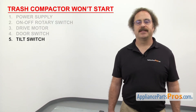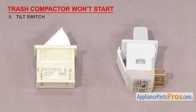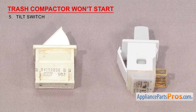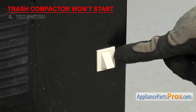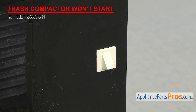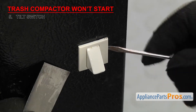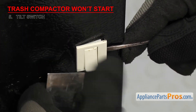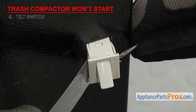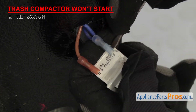The last thing to check is the tilt switch — it's a safety device that shuts off the power if the drawer is forced open during a cycle. The tilt switch is a small switch with a rocker arm and two wire terminals; the rocker arm is pressed in when the drawer is closed. It's located on the front of the cabinet on the right-hand side. If the trash compactor won't start, it could be that the tilt switch has failed. To test the switch, open the drawer. These can be a little tricky to get out — the locking tab is on the right-hand side of the switch. Use a small screwdriver to press on it and a putty knife on the other side to help work it out. Once you have it out, remove the wires so we can test it for continuity.